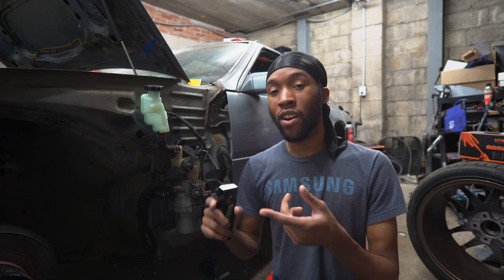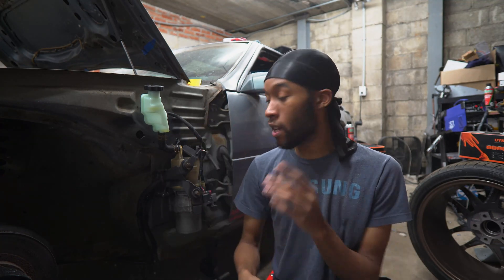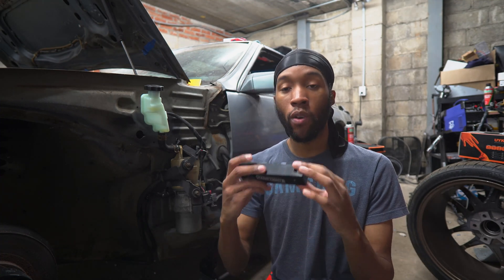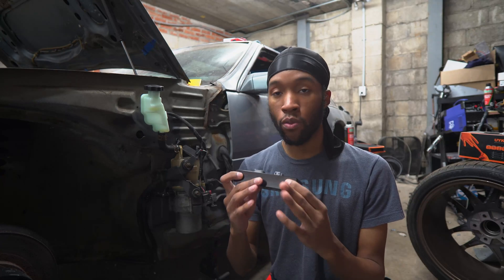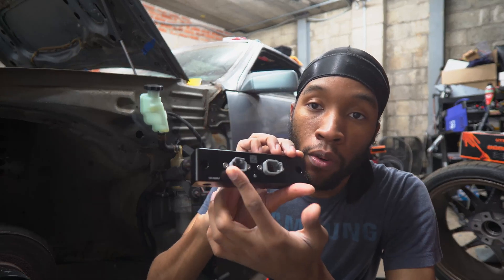It also gives us controllability, allowing us to control the speed of the pump through a potentiometer, or like normal cars, either off engine speed or wheel speed by sending a PWM signal to the controller, which then sends the signal to the pump. The wiring is ultra easy — 12 volts, ground, the CAN bus, and its own connector for the potentiometer or ECU control. For this video we're just going to do the potentiometer.